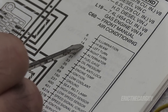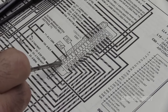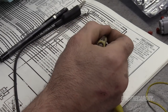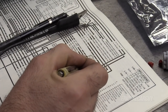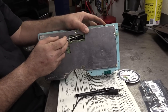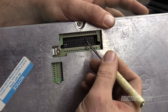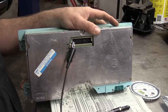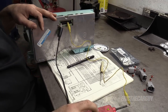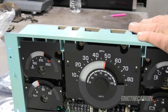Left turn signal is coming in at pin 14, which is right down over here. I'm going to count down on this, because it's on the opposite side of where our ground is — so we're flipped upside down when we go on the cluster. On the other side, that one is seven in from the top. So we'll go up to these pins and count seven in — one, two, three, four, five, six, seven. And that pin right there should be the left turn signal indicator. Hook up my power, and we can watch the left turn signal work. That's me doing it manually — it really doesn't blink like that naturally.